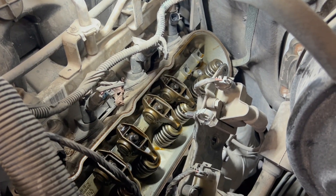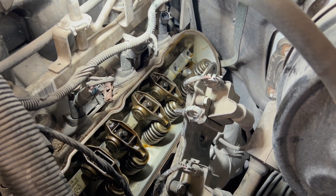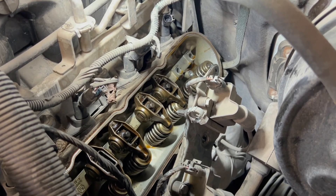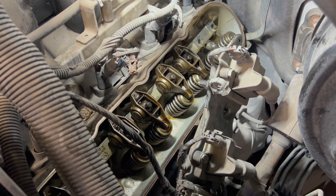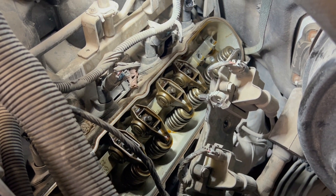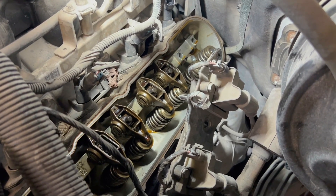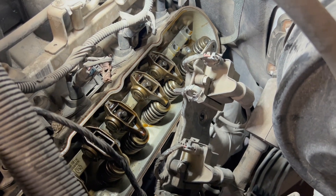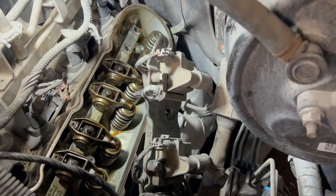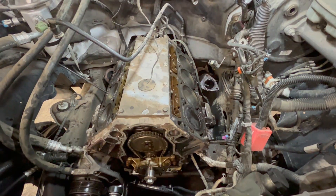We 100% know that is our cam scrub noise - we've wiped the lifter on cylinder seven. That's something I'm pretty excited about, something I've actually never done before. The noise went away, and that's how you can pinpoint if you have a cam lobe that's wiped out: take the pressure off the cam, take the two rockers off, find the misfiring cylinder first - a good scan tool with a misfire graphic will help - then disconnect its rockers, pull the push rods out, and you essentially remove the roller lifter from the camshaft.